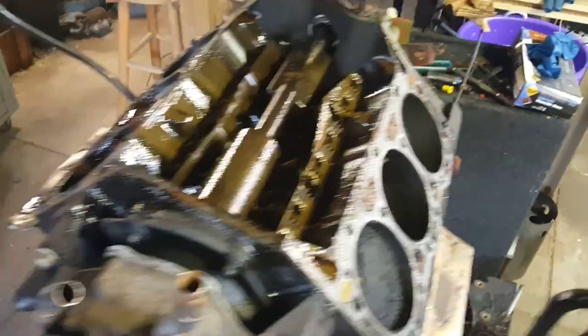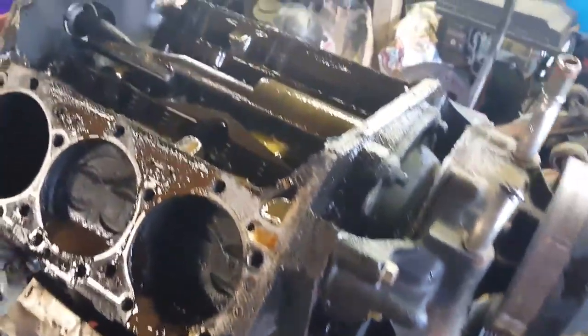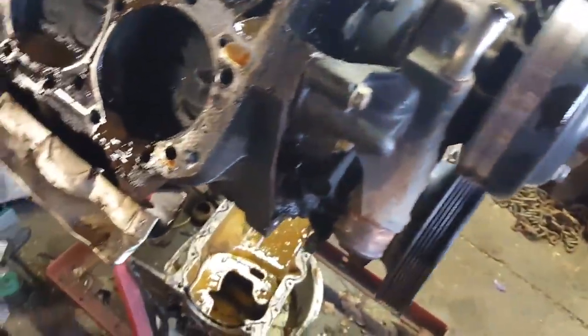Wait, I take that back. The bearings — the bearings are probably scorched up. It's a loss of lubricant due to the coolant getting into the oil.